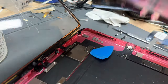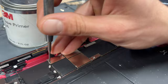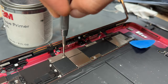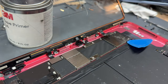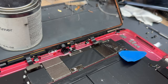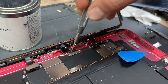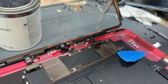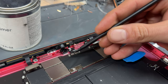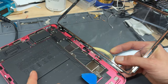I'll use some tweezers to lift off the shield and then disconnect these two connectors using the plastic spudger. The LCD can now be lifted — it's stuck down a little bit but not hard at all. Take it out of the way and put it safely aside for reinstallation later if you're keeping your LCD. Remove the two screws on the shield at the top, use tweezers to remove the shield, then with the plastic spudger disconnect the digitizer connector. There are also a couple of screws holding down the front microphone and the sensor — remove those, take off the shield, and disconnect this one connector, noting the other one is for the front camera. With those disconnected we can now separate the digitizer from the chassis.